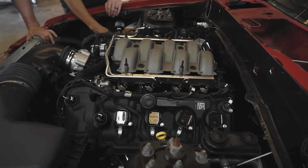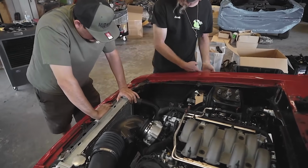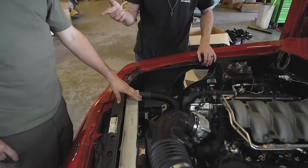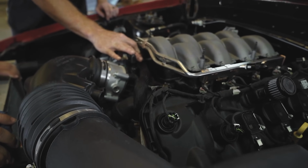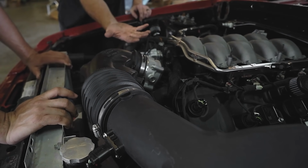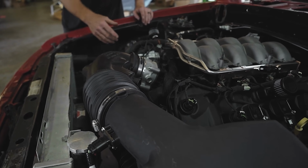Talk about the turbos. So the CG fab header is coming up right here. That can go up right here. The turbo here. All you have to do is modify the up pipe. I'm sure you have someone that can do it, but if you can't, let me know and we'll get it done. The reason I did this above it like this for now is because you're going to have the Cobra Jet, and this will sit underneath the Cobra Jet, and then it won't be a problem. Right now, you have to take the intake off. Later, when you do your other intake, this will be perfect. So I built it for where you're going and not where we're at.